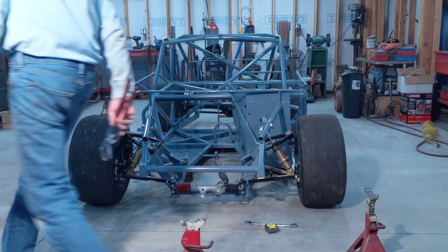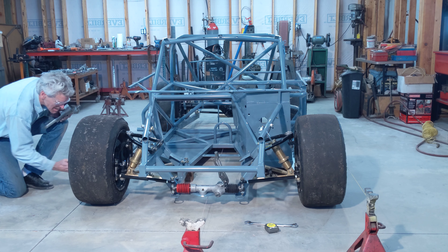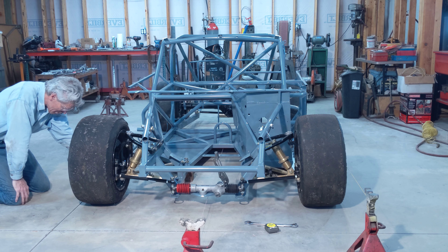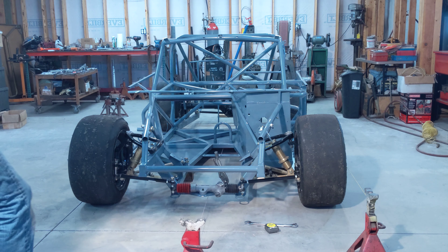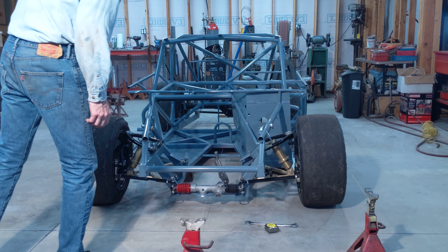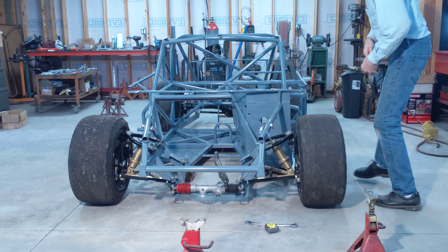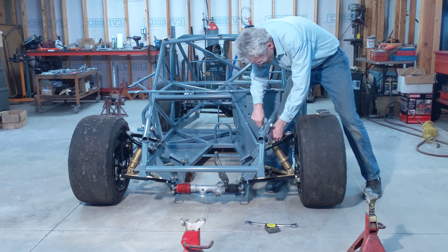Check it on the other side. This side is two degrees. So I think I'm going to make the driver's side two degrees to match. To do that, you take shims out of the upper control arm. While you're doing this work, you want to make sure you don't knock into your strings. And then just to be safe, check your strings again for center.